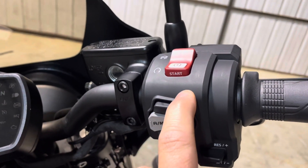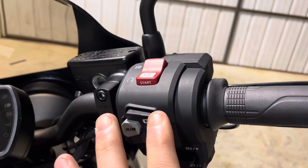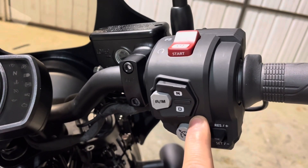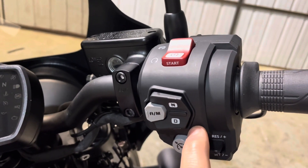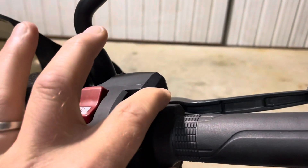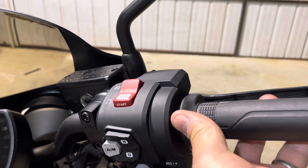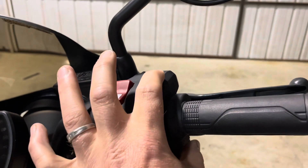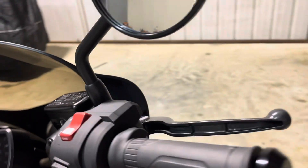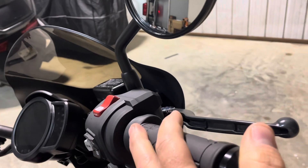You will see a big silver screw right behind — leave that one alone. There's a smaller silver screw just below it that you will need to take out. Once that screw is out, there's an assembly in here that will allow this whole unit to come straight out of the assembly. There will be no adhesive involved in getting this one on or off — there's play in there and it just locks into place when you're done.